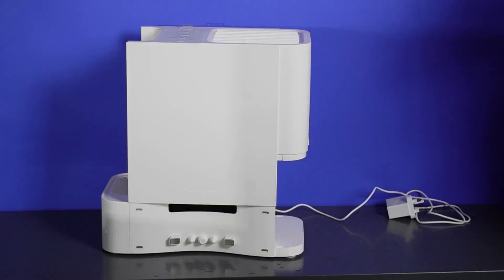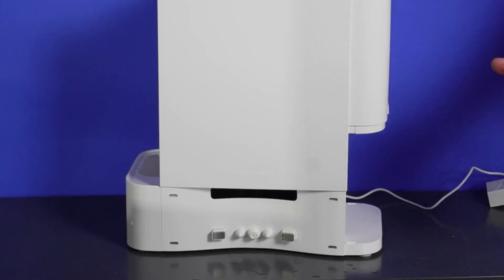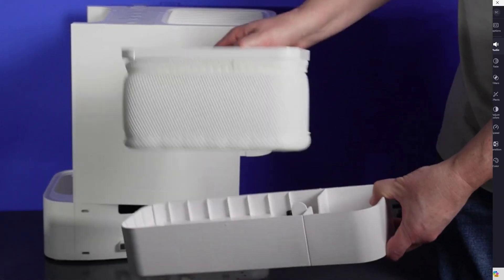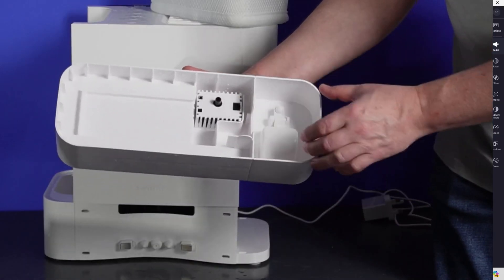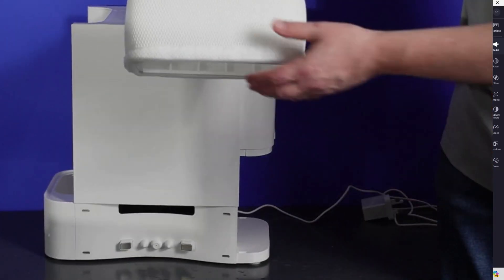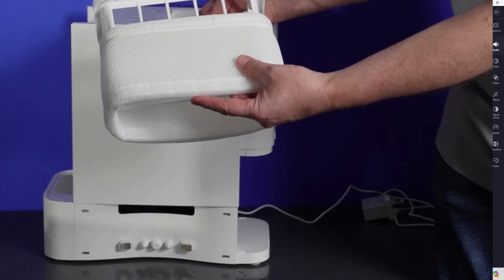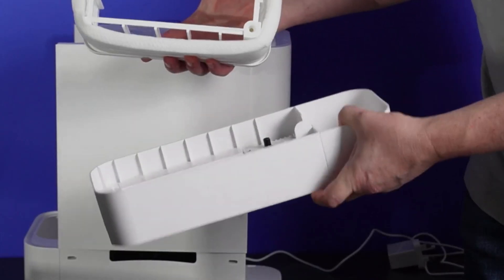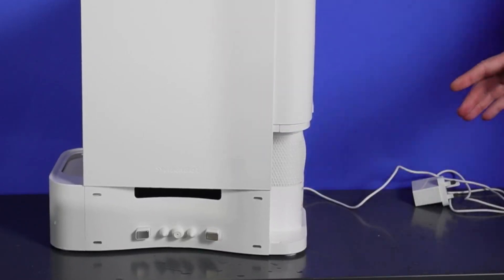If the water ran low, the indicator would change to red. Looking at the front of the unit with the cover off, you can see where the SwitchBot S10 robot can come along and top it up with water. This is the filter unit that disperses the water — it lifts right off the top. At the bottom you can see the water tray and the little pump that pumps water up to the top and distributes it down through the filter. The filter element can be taken off and placed in your washing machine. When placing it back, make sure you press it in with the little circle going over the pump, then slide the unit back inside.